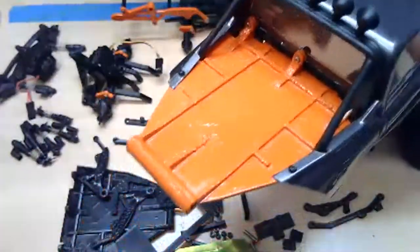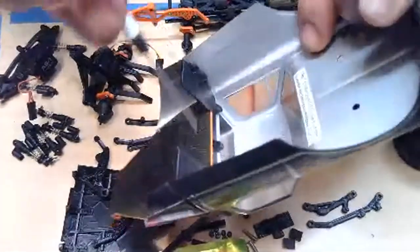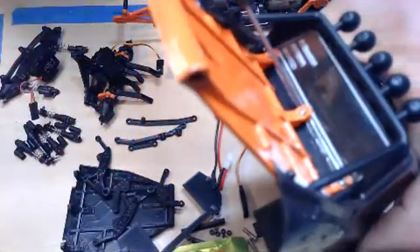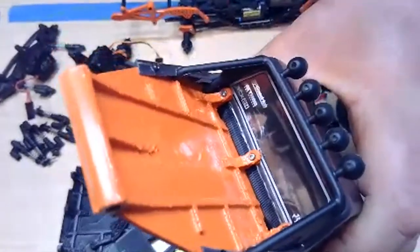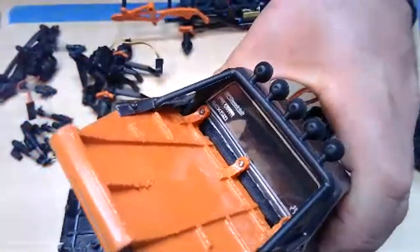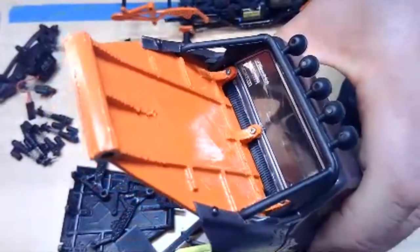Once you get the block off plate in on the inside, you can drill these three holes here. Once you get these two and you bolt it in, you can drill these three holes through. As you're looking from the rear, you can see where you need to drill them to line it up. You'll want to use probably a 1.4, 1.6, or 1.8 millimeter drill bit, something around there. That should give you just about exactly what you're looking for as far as the hole diameter.